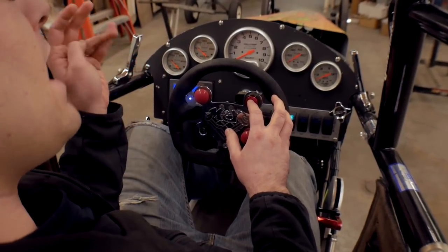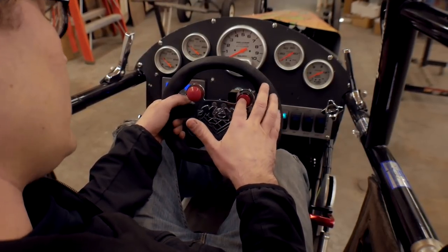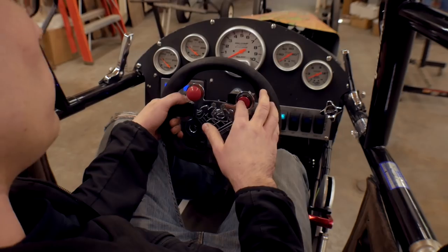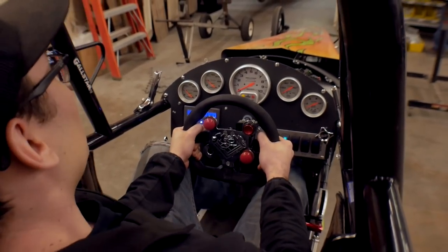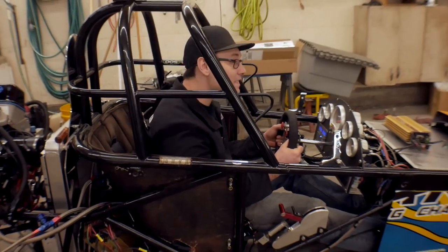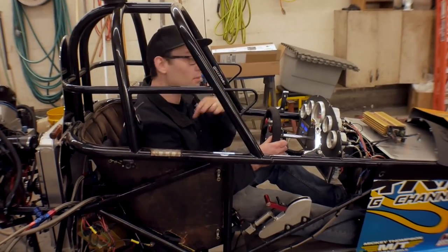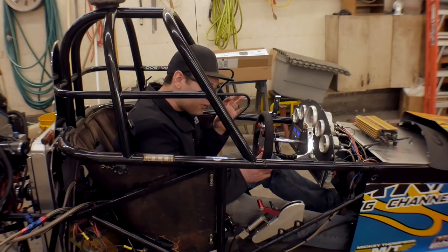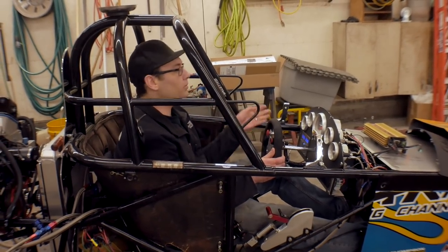At this time it's ready to go in and stage — a lot of things happen quickly now. I'll go ahead and bump the car into stage. Once it is staged, click the trans brake button, release the brake pedal, and wait for the bulb to come on. Once the bulb comes on, I'll hit it — go up with my left hand, flip the visor down, both hands on the steering wheel, throttle all the way down. Once the trans brake releases, the car launches. I'll get sitting up in my seat, try to find my opponent on the racetrack whether I'm looking forward or back, get an eye on the finish line. The car is going to shift itself — there's nothing I need to do there. It's air shifted off of time and it's going to shift at 2.7 seconds throughout the run.